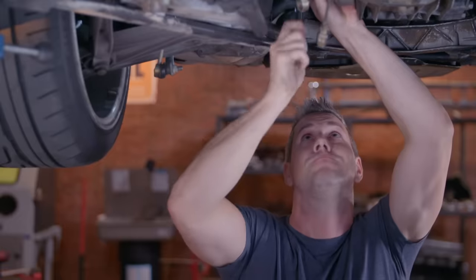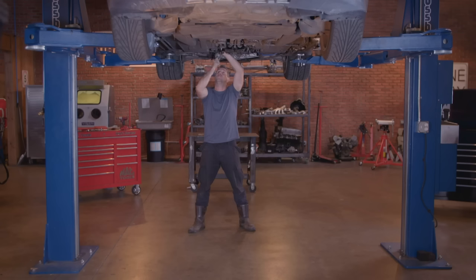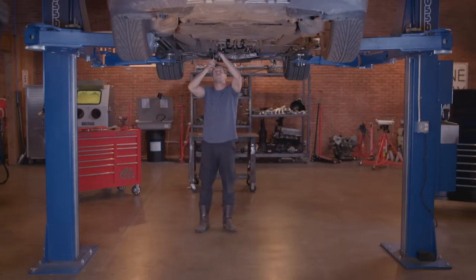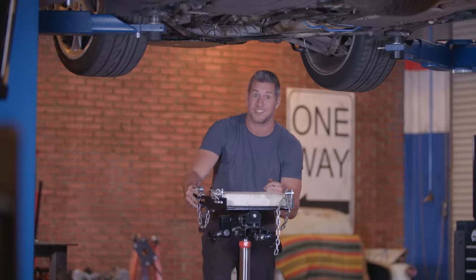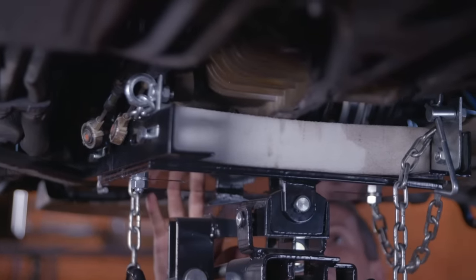The purpose of the intermediate shaft is to drive the camshafts indirectly off the crankshaft. If you do your research and have a little look online, you'll see that this bearing is a big fear for owners of 996s, and any potential buyer is going to want to know that it's sorted.